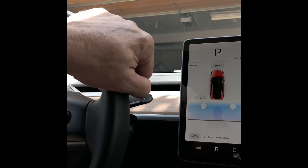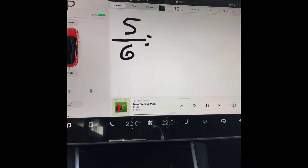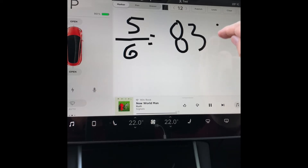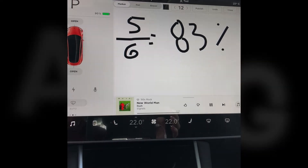When you take your car in for a tire rotation, they'll measure your tread depth for you. If they give it to you as a percentage, ask them how they got that number — it should be measured in millimeters. If they really did calculate a percentage, assuming your tires measured at five millimeters and were new at six, that would come out to eighty-three percent. But I don't think they ever do that — they just eyeball it. Ask for a millimeter measurement.